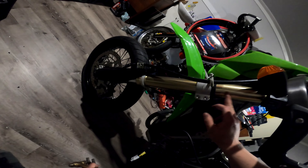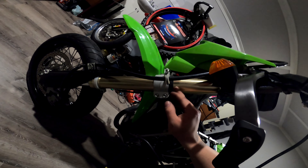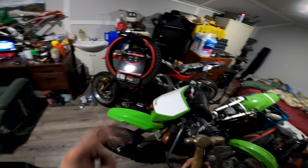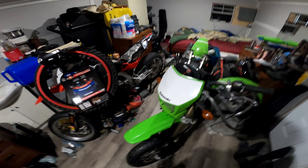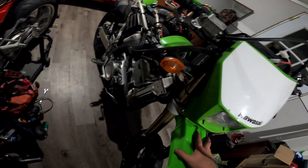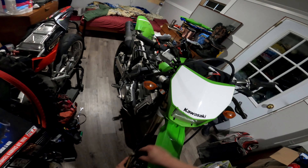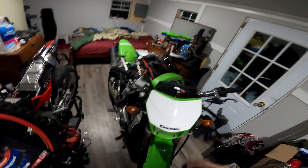I've actually lowered the front suspension — I don't know if it's meant to be lowered this much, but we're going to try it out. We've put the forks right down to the bottom of the perfectly machined surface. That'll do two things for us in supermoto: force more weight onto the front wheel which helps cornering traction, and also gives the speedo cable more slack so at full suspension extension it's not ripping the back of that gauge cluster.